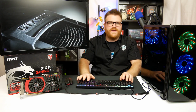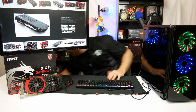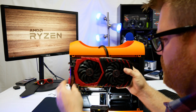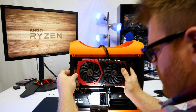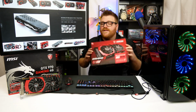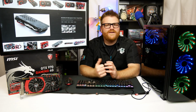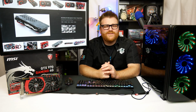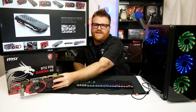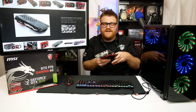Also, case in point, let's see here. This is an RX 580. I actually have the box for it here that I stole when I did a build for Computer Doctors. This is in a PC over there, and it's an RX 580 with a 3 heat pipe solution and a backplate, and not necessary, because the RX 580, the Polaris GPU on it, doesn't get very hot. So it's mediocre, but it only has one 8-pin connector. You can see this actually takes an 8 and a 6. So you would think that this would need a beefier cooling solution, but it doesn't actually get that hot.